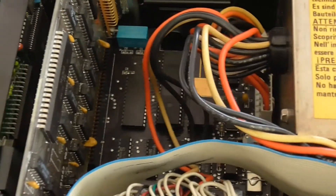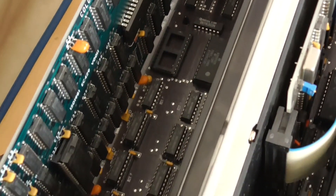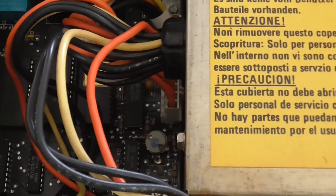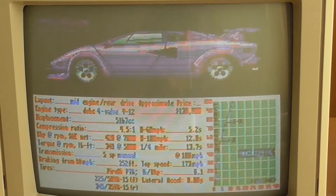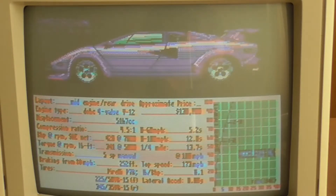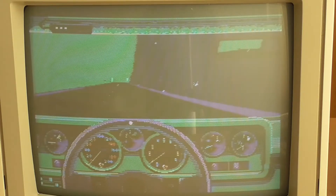The really weird thing is that the trim pot is not on the graphics card — the CGA graphics card is plugged in at the end. It's on the main board for the computer itself: that little white circle with the blue screwdriver slot. So if you just load an ordinary four-color CGA game, the colors will all be wrong and the text is really hard to read. The reason is it's just picking pairs of pixels and trying to assign colors to them, and those haven't been chosen by the game designers to look good. In the driving mode it really looks quite terrible — very green and dark — and you'd prefer to play in the original four-color CGA mode.